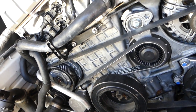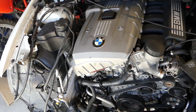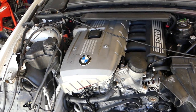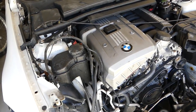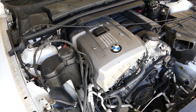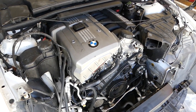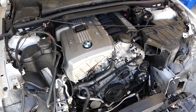What will reduce your oil leaks and the risk of developing an oil leak is changing your oil more often. Do not go 15,000 miles like BMW suggests — I usually go about 7,000 to 7,500 miles with BMW-approved oil. That's it for today, guys — just a quick video to share with you, thank you for watching.